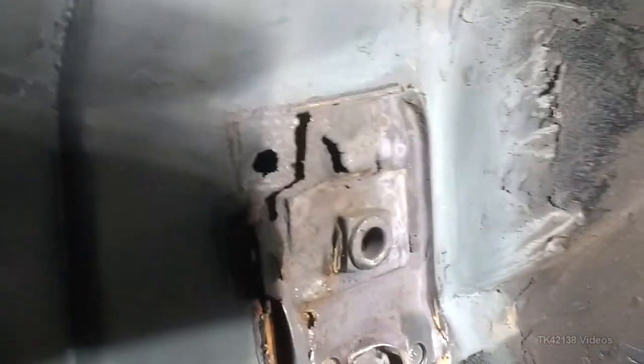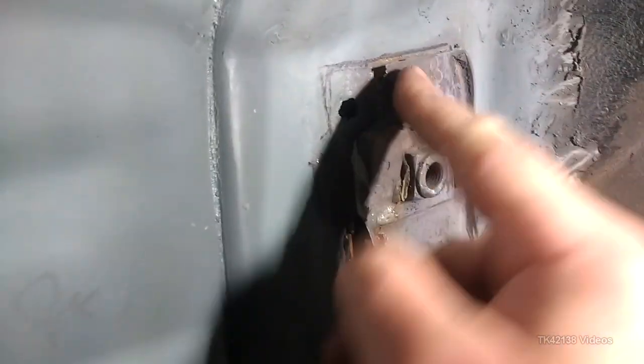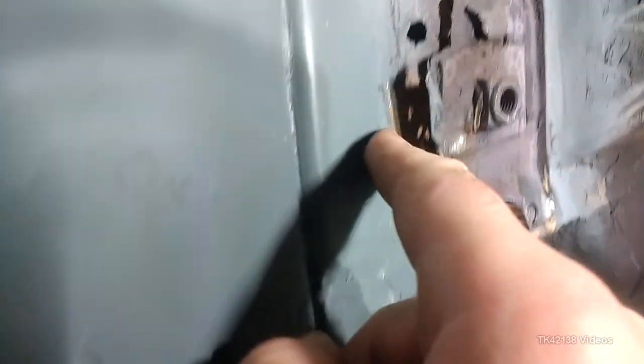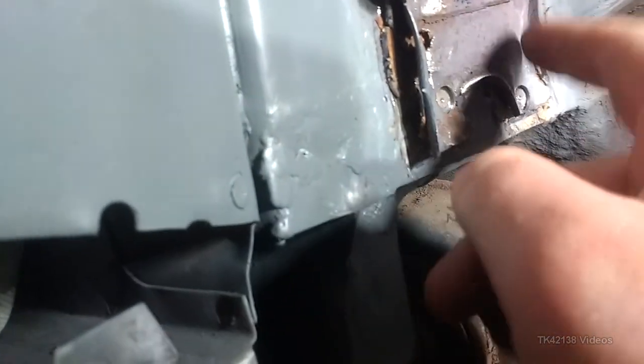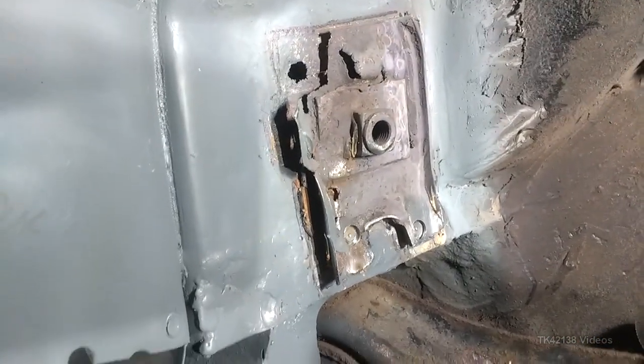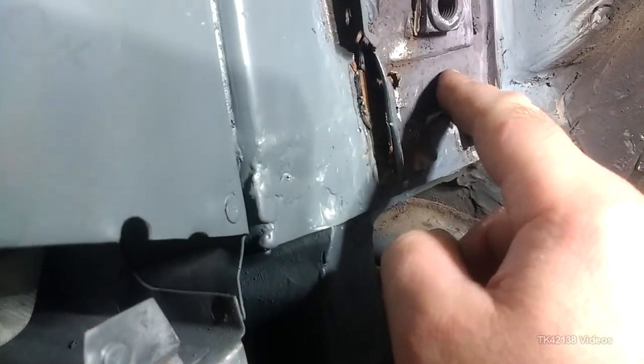So that's what it looks like close up - there's corrosion. This projection here is rusted out, there's a whole bit missing here and obviously some holes there. But at least the surrounding area - apart from the work I did yesterday - is okay. I figured before I put all the wheel arch back together I might as well do this while there's a bit more room. And yes, there's a spot weld right there.